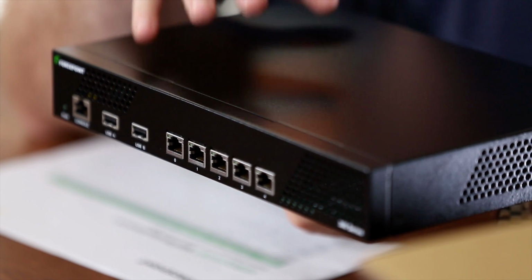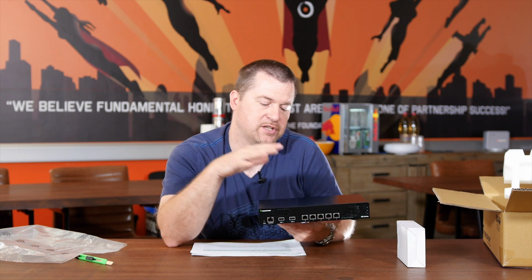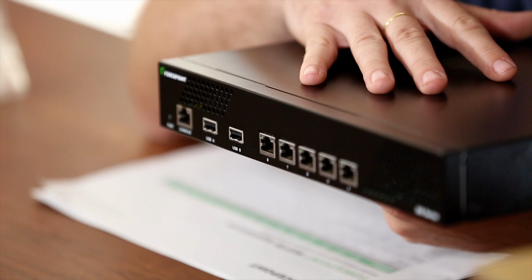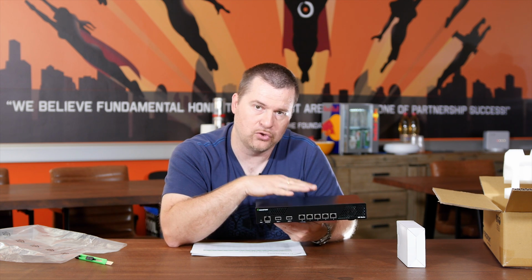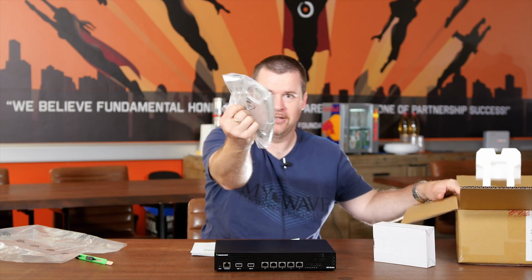Actually, the USB ports on this firewall have a unique feature, because USB ports can be used for initial configuration. Meaning, when you do the initial installation of the firewall, you have to enter the IP addresses, the private keys, the router stuff and everything on the management system, and then transfer everything with the USB stick. If you put the USB stick in when the firewall is booting, the firewall will read the complete configuration and do everything by itself to connect to the management, so you don't have to even use the console port at all. But if you would like to follow through with initial configuration, you will have to use that.